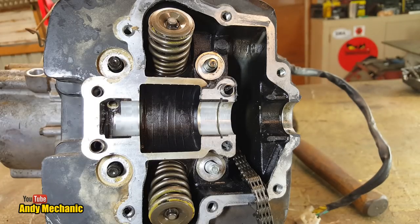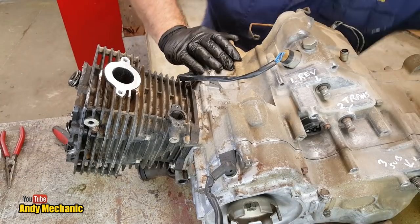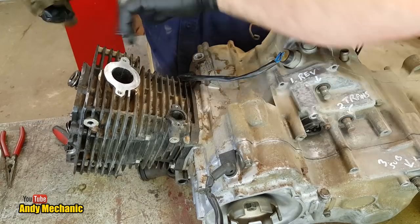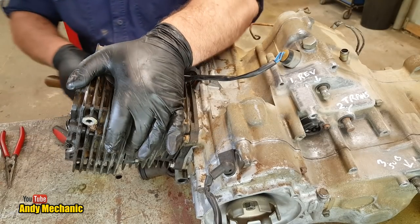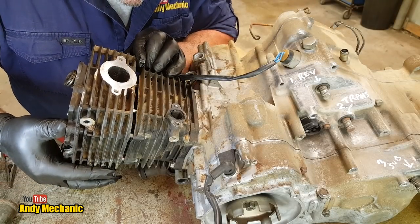Okay, right. It's four washers, four nuts. Put them on the recycle pile. Okie dokie. Okay, well, we can split that head. Time to move the camera again. Okay, magic hammer. Now, normally you've got to give these a little bit of a tap just to break the head gasket. Sorry about the earthquake. We've got the camera mounted on the same bench today, which is not normal. There we go.